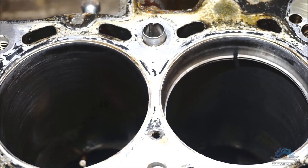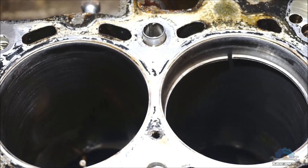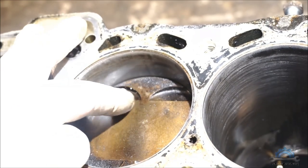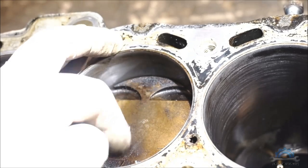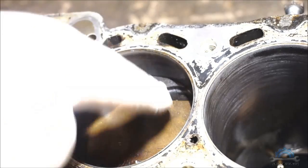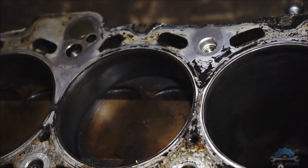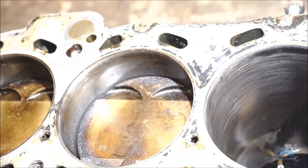If you don't see blue smoke on the exhaust, where is the oil going? It's still going through the piston rings. There is a tiny amount of oil that is burned. Have a look at the piston: the M52TU with good piston rings shows no deposit at all. On my website you can see my pistons after two years of use — the head was taken off, the head was rebuilt, and the piston was cleaned. After two years there was a significant amount of carbon deposit everywhere. So the only proper solution to stop the oil burning is to change the piston rings.